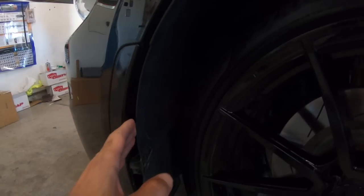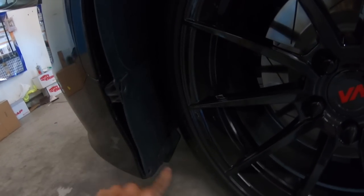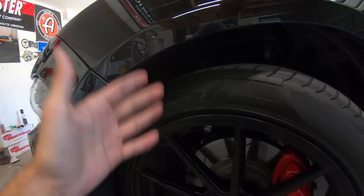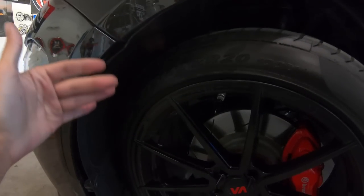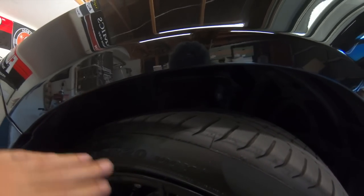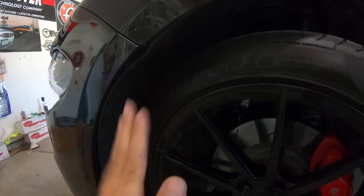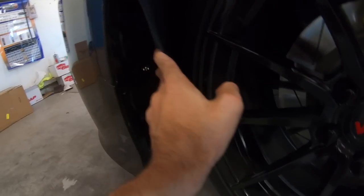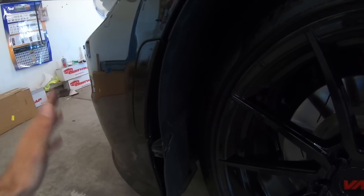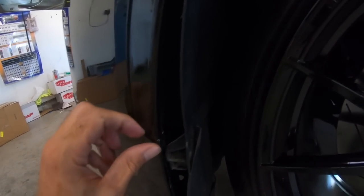All right, guys, so a few steps on the bumper removal. There's some push pins right here. You pop them out. You may be able to do this without jacking the car up or not. This car does have bags, so I do have a lot of lift and room in the front when you crank the wheels. You will have to disconnect the fog light. Again, if you have a Scat Pack, Hellcats do not have it. And the side marker, the plug is in the bottom.